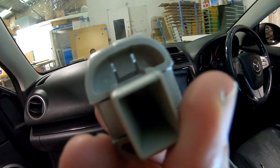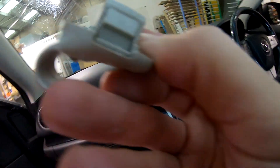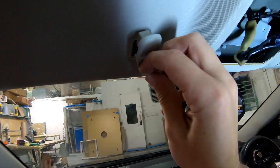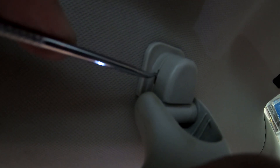This is how it's holding on — you push here on the tab and here on the tab, that's it. From here it just pops out. On the handle you have a slot here; put a pick in and pry outwards, and on the other side there's the slot — pry outwards.